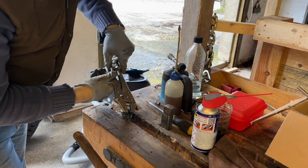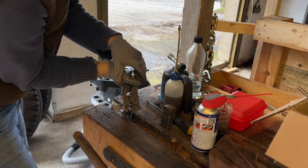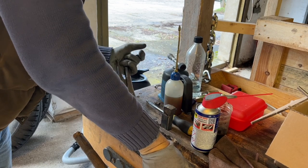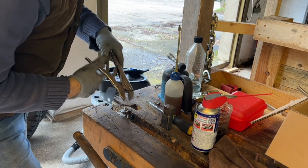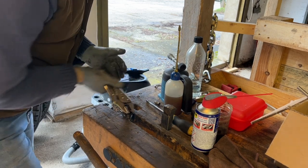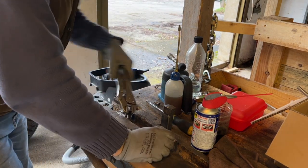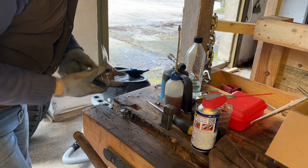This is amazing — it's an alloy part with a steel nipple going into it and it's original to the car, so it's 45 years old. That Porsche there is nearly 20 years old, and pretty much every steel bolt that goes into an alloy housing — you can forget it, it's going to snap and you're going to have to drill it out. I've had so many of those cases during the restoration. But with the Land Rover and the Girling parts, heat them up a little bit, give it a bit of oil, and out they come.